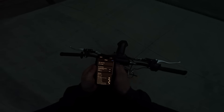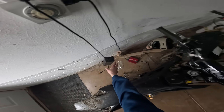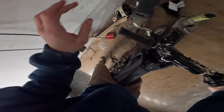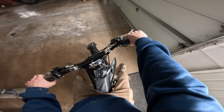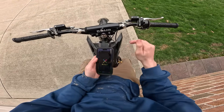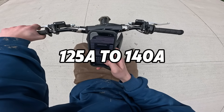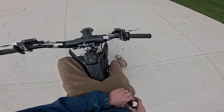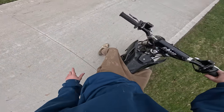This is day four of having the bike. Chain is good and adjusted now, power is good. I can still turn up the power a bit more - let's add another 15 amps and go take a little rip. The chain definitely needs an upgrade from the factory stock chain. It took me about an hour to get it properly adjusted - it kept falling off, and it was too tight just to keep it on. Definitely upgrade to a 420 chain.